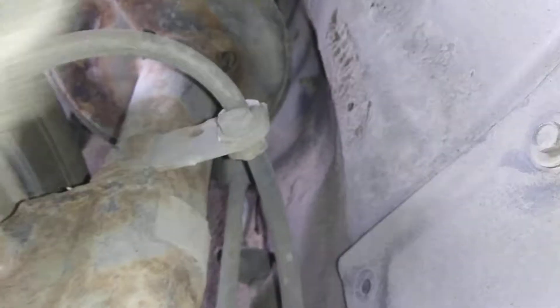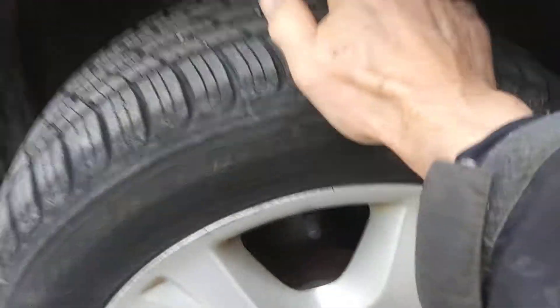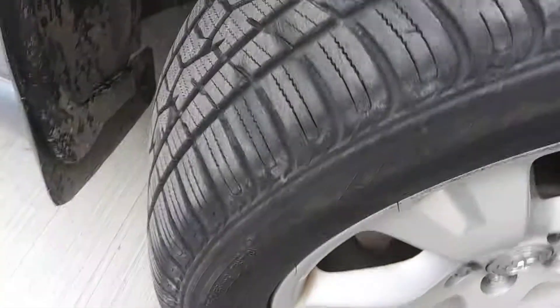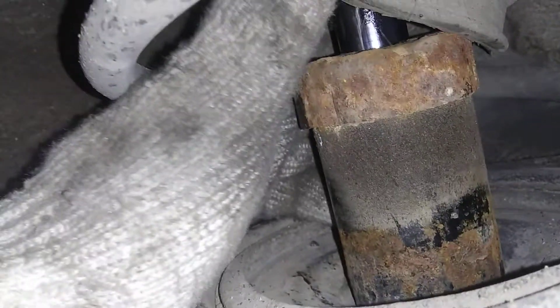Here's your flexible brake line and no cracks that I could see, so everything looks clean on this side of the suspension. With the jack under the front suspension and the wheel lifted, the lower control arm is tight and the outer tie rod is tight as well. Your front brakes have about 20,000 K left on the front right. The inside of the strut is good and dry — no oil leakage on the front right strut.